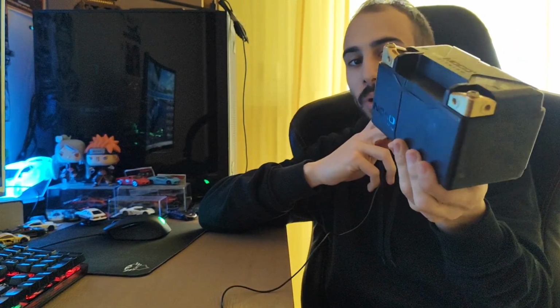For the guys that are interested in the talking part though, I have, as I said, the NLP9. It is the second smallest Noco battery. The smaller one would be the NLP5, but don't even think about it. And even the NLP9 will be giving me some headache, as I've understood, because it does have a lot of power. This little tiny guy weighs only a kilo, and that is with all the plastics around it for the adjustment of height. I have removed the plastics below. There is an adapter, and the plastic right here, actually it's metal on the top side. I've removed it, and it weighs 900 grams. Not even a kilo. But I would still not advise the NLP9.